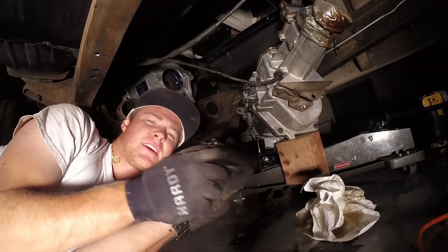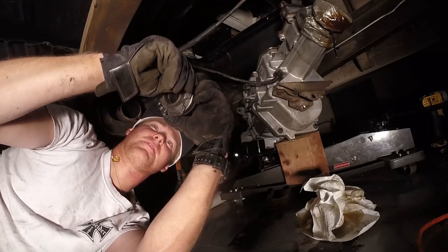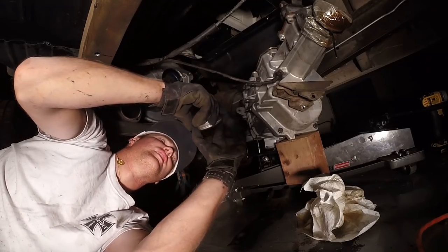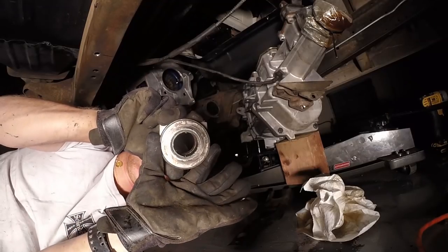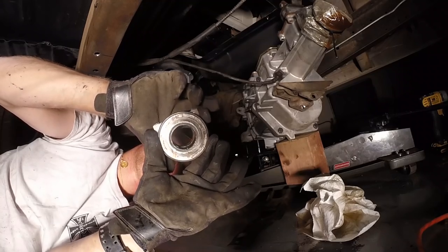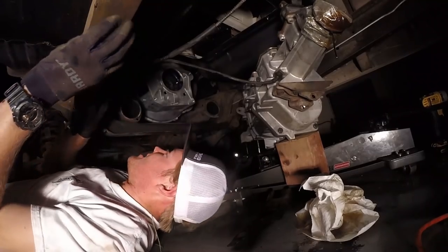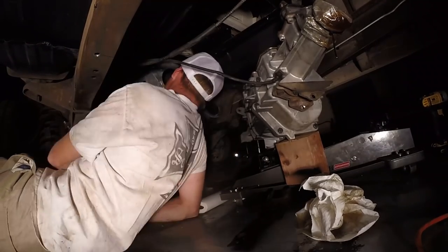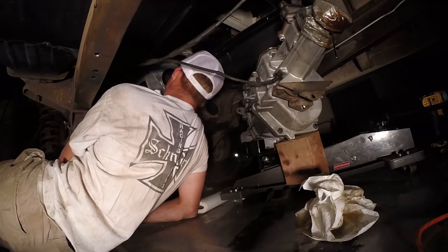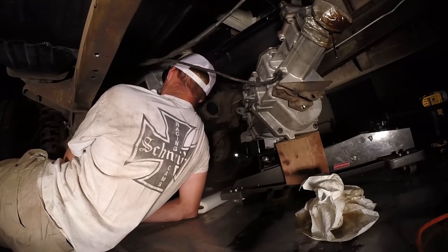You can see these clips right here on the sides — they shouldn't be able to do that either. They should be a lot stiffer than that. They can move, but not like that. So that thing is going in the trash can — I have another one. Let me look at the clutch, because that's really what's concerning me. I don't see anywhere on the fingers that concerns me, which is good. The clutch on this thing is still fine. The pressure plate and the clutch look fine.